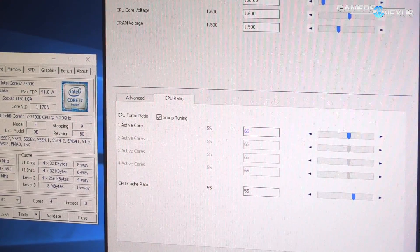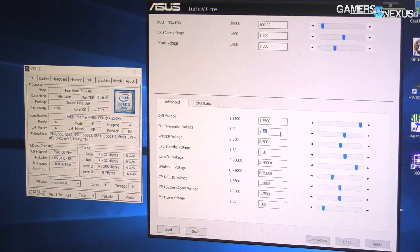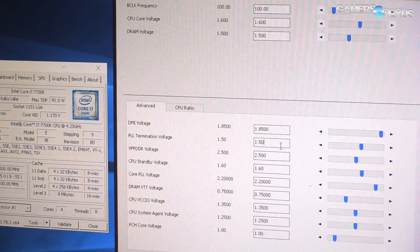I can explain some of the other voltages too. DMI voltage here is at 1.85, which is quite high. The problem is with a very low DMI voltage you would lose display signal when you cool down. One solution is using the VGA on the PCH in the last slot, but when you want to run 3D benchmarks you have to use the first PCIe slot, and then you need to increase DMI voltage to 1.8 or 1.85. Otherwise you would lose display signal — so that's also a very important voltage.